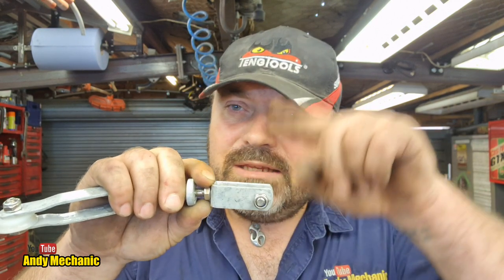I don't think personally this kit is suitable for use with that brake design. I think it needs a cable with an outer. The outer basically ends at that bracket. It locks into place. Usually there's some little spring clips or a plastic molding or something, and then the inner would then protrude with a similar kind of thing to that on the end of the cable, but smaller, and that would then bolt into the arm, the quadrant arm on the back of the brake drum.